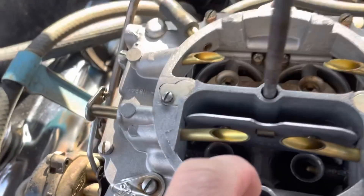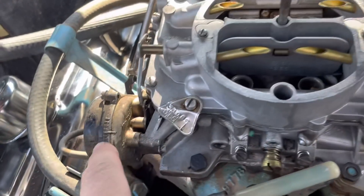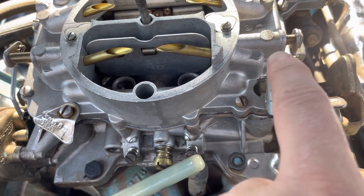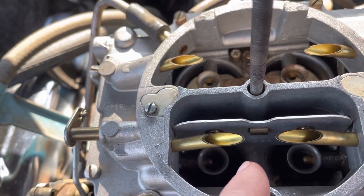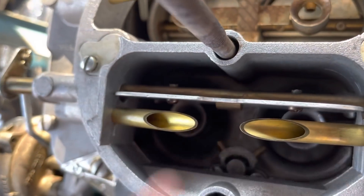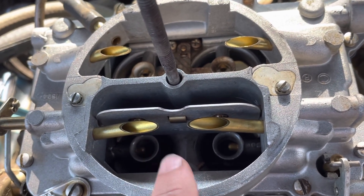I've got the accelerator pump fixed. These are the two pump discharge nozzles — that and that right there. If you take the top of the carburetor off, there are just these peripheral screws, the clip for the choke, the clip for the choke pull-off when you floor it if you flood out, and there's a clip for the accelerator pump. There are two issues: the accelerator pump was dead, and also the check ball and brass plug — there's a check ball and a little brass plug that sits on top of the check ball. On these Carter AFBs there are two screws that hold the discharge nozzles in place. You take that out and the check ball and brass plug are underneath it. Those were stuck, so I was not getting any fuel discharge.